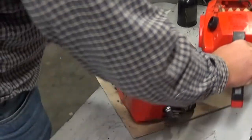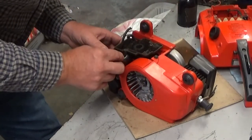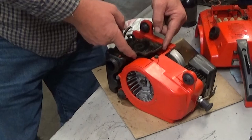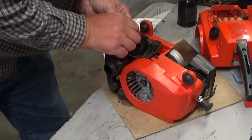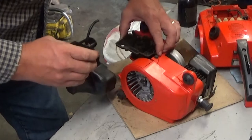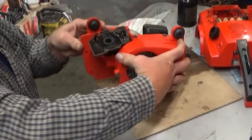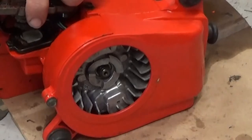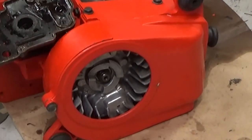Like I said early on, it's nothing extremely difficult — but if you don't know what you're looking for, it can be a pain. You see what I'm doing here? If that intake boot was still connected, it wouldn't move like that. So what we're going to do is get the fuel tank out of the way — I've got to put a new fuel hose on that. The rest of these hoses don't look terrible. And look — that boot just shrank and disconnected. There's nothing else I can say for it.